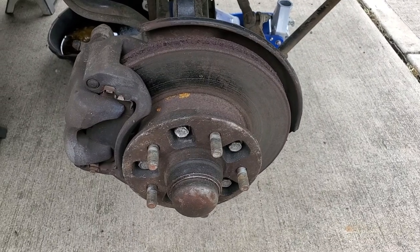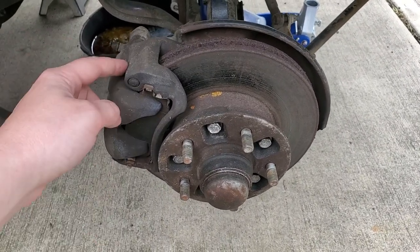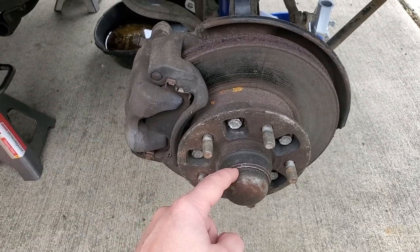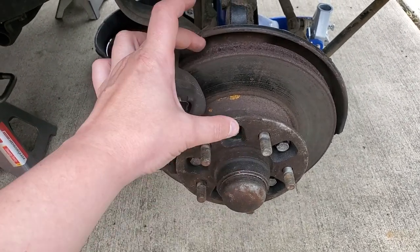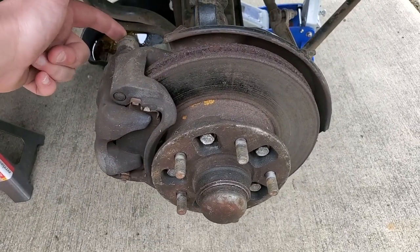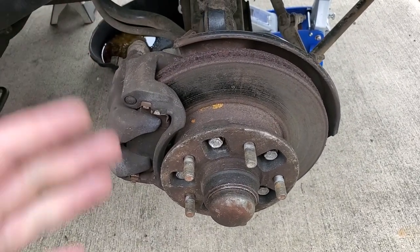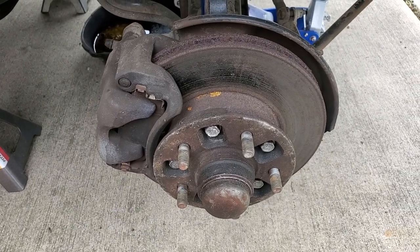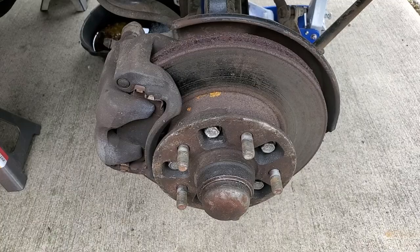In the order of operations, the first thing I need to do is take the brake caliper off, then I'll need to take the dust cap off, take that nut off, and then the whole rotor and everything will come off the spindle. Because the bolts are back here I'm just going to turn my wheels to the left — that will make it easier to get my impact driver back there and take those off. I believe they're a 17mm socket.